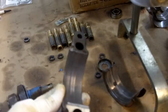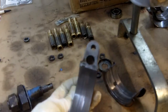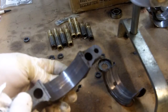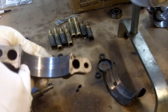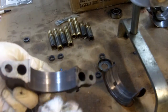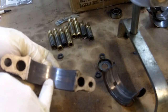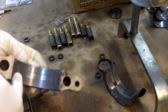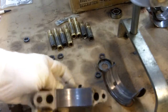The problem with the lack of oil changes is the dirt that gets circulating through here. What we're looking at is the main bearing and the main bearing shell. This is supposed to be shiny silver-white looking metal, and it's tarnished now. I believe this engine was in storage for quite a while. You can see the copper backing underneath — that's underneath the layer the crankshaft rides on. When that layer gets worn out, you get down to the copper, and you're not supposed to get down to the copper. That's too much wear.